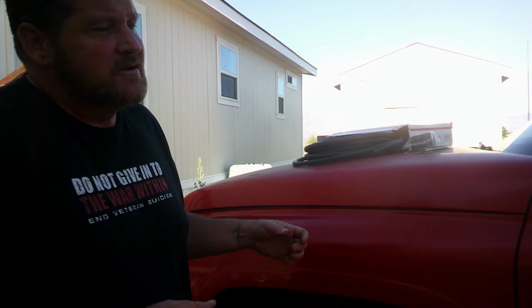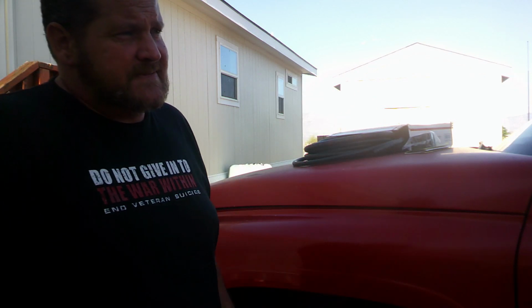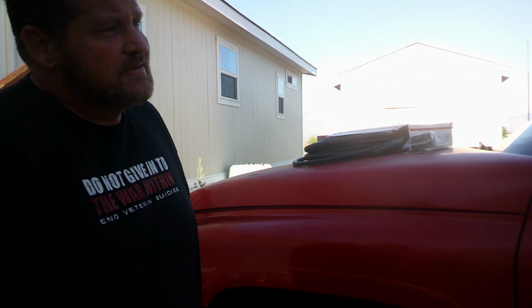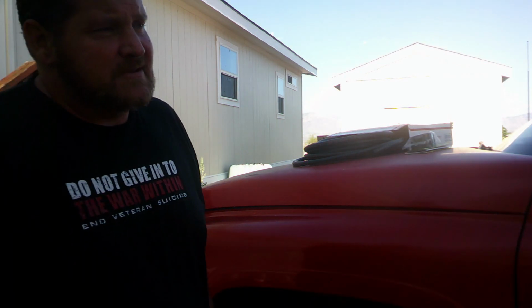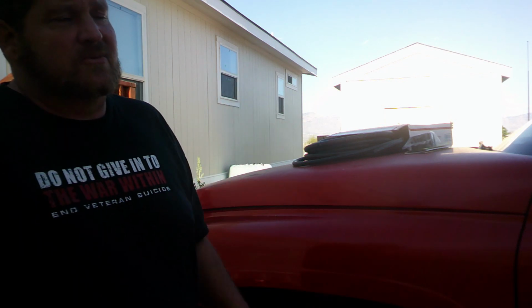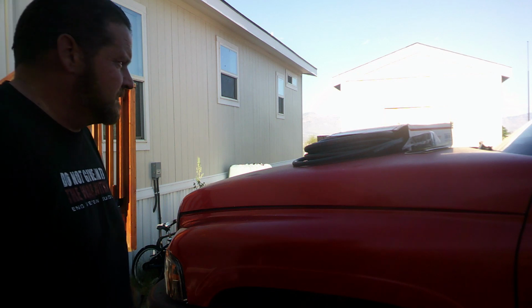Now the reason I'm keeping that filter is because of my auxiliary fuel tank in the back of the truck. They don't have really a built-in vent system, so the vent system is the cap leaks, basically. Which I guess in the desert isn't too horrible of an idea, but during monsoon season, rainwater just dumps in there. And having that drain back there is really super easy for me just to walk out here, turn a screw, drain the water, turn the screw back, and be on the road. Not have to worry about all that hustle and bustle.